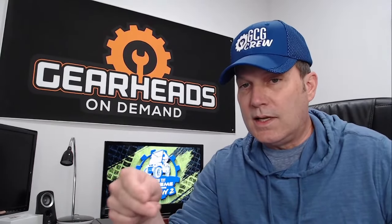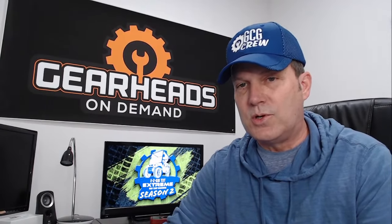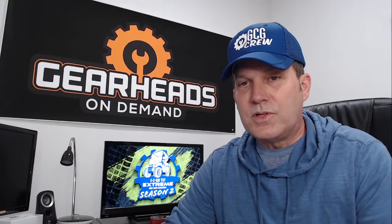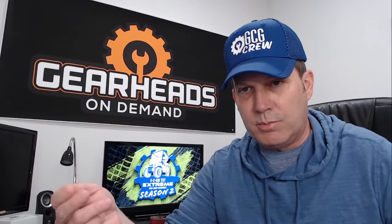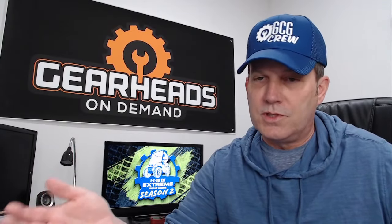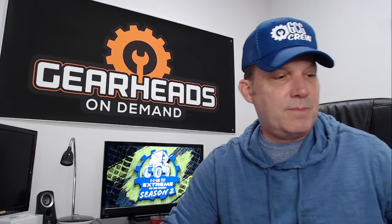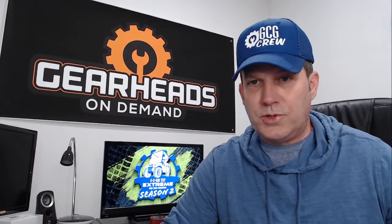After 14 days, this is what it says in the service manual: if the charge cycle is not interrupted, the charger will come back on and charge your cart. Also, you'll know this when you come back to your cart, the yellow light on the dash should be blinking. A lot of people think that yellow light is just for low voltage. Well, it's not just for low voltage. It will come on for low voltage too, but it will also come on to let you know as an owner that the charge cycle was interrupted on your golf cart.